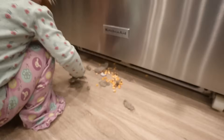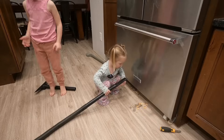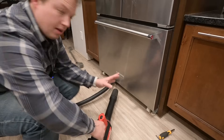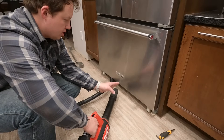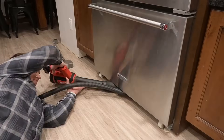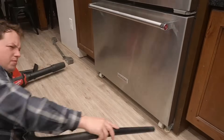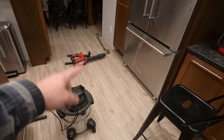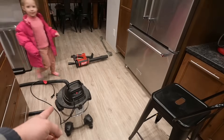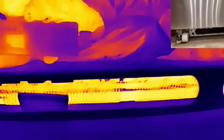Should we get a big vacuum cleaner to suck up all the junk we're finding? Another thing you can do to break free some of the dust and debris is use an air compressor — or I'm going to try this small leaf blower — to blow the dust around while you have your vacuum running at the same time. That combination of the vacuum and the leaf blower worked really well, though we did have quite a bit of dust get into the room. Here's what the coil looks like after we cleaned it — we can see back in there pretty far.